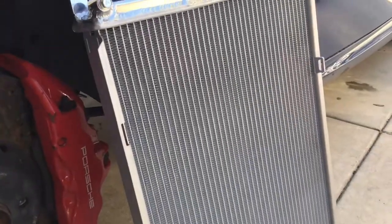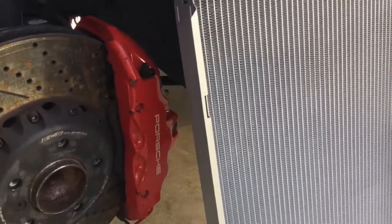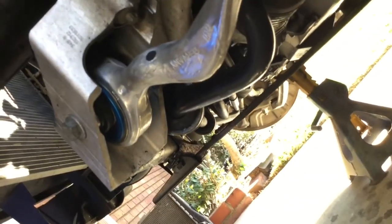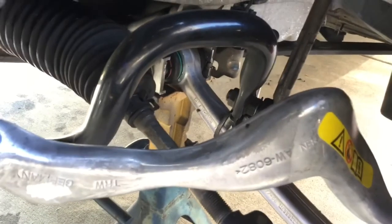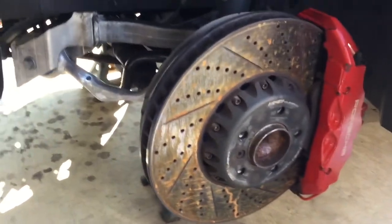It's supposed to be more efficient, but I don't think we'll really see a difference unless we change around the cooling maps. Another upgrade I really enjoyed was Turner's monoball — those things are fantastic for getting rid of the slop in the front end of this car. It also came with M3 lowers, so there's a monoball there too. Those two front-end upgrades completely transformed this car.